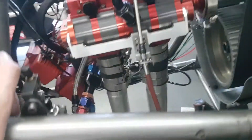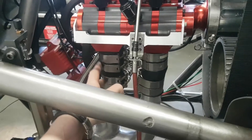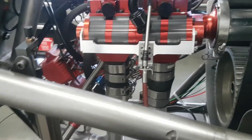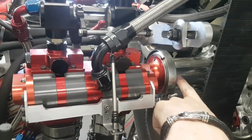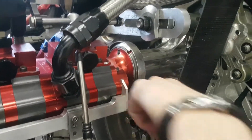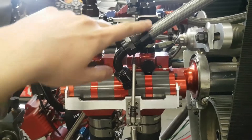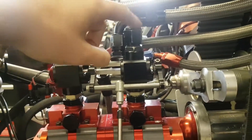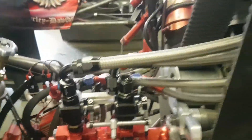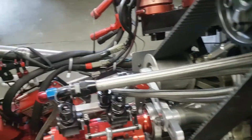Now those lines go up to — there's our fuel pump, you can remember that discussion — double hose clamps with the rubber fitting again. There's the body connected in the snout, connected to the front of the motor right where that cam is. See that direct drive. You can see we've got our fuel shutoffs with our fuel linkage here. Now we have these capped off because when we're doing work on the car, we generally do not have our main fuel lines connected.